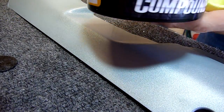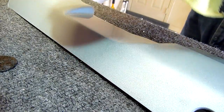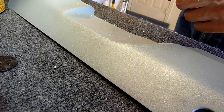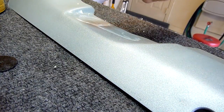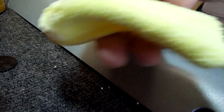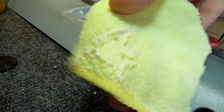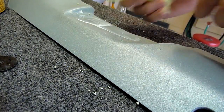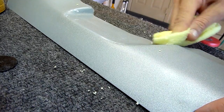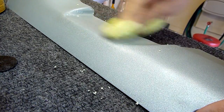What I'm using now is a Meguiar's polishing compound. This has less cut than the rubbing compound, so it'll put a higher polish on the surface and get out the finer scratches. I use these little pieces of microfiber cloth — I buy the yellow microfibers at Costco, you can get about 30 of them for $14. They're really good for applying polishes or wax — cheap and perfect for that purpose, though not great for drying a car since they're not very absorbent.